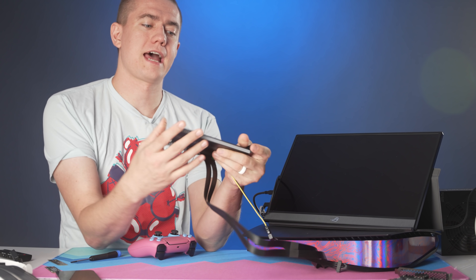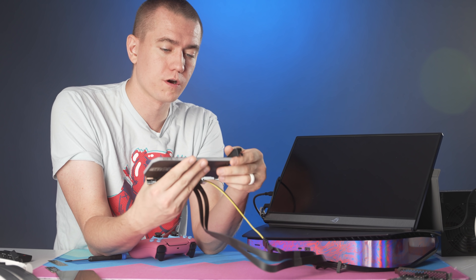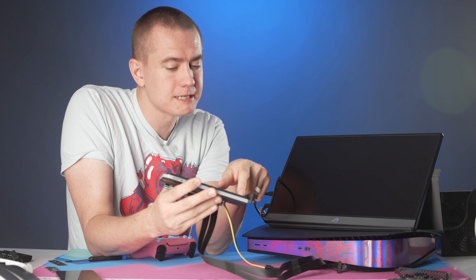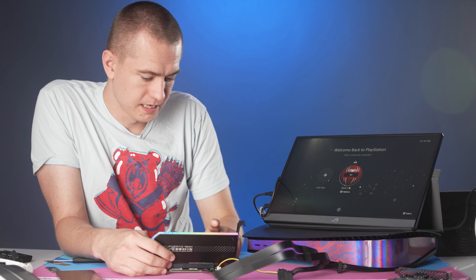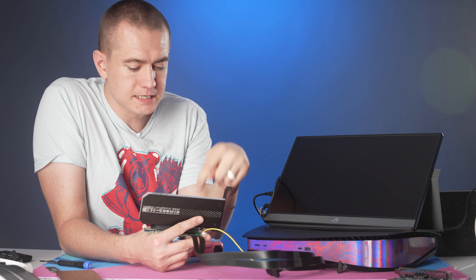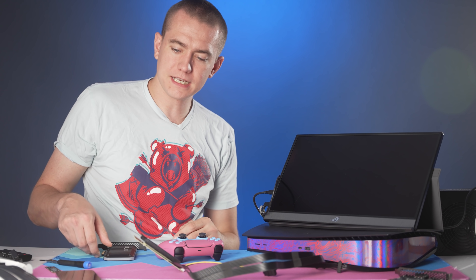This is the cool one — this already has RAID built in. If I can get this one to work, that would let me know that a hardware RAID card could actually work in the future. The only issue is that this is PCI Express 3.0 and I couldn't find a consumer PCI Express 4.0 version on the market. RGB turns on when we turn on the PlayStation — it's at least conceptually receiving power. But it did not register at all. My guess: because this isn't a full 16-lane card, it's not registering on the PlayStation.